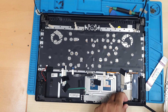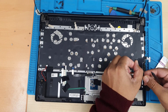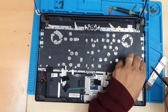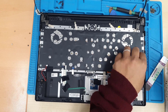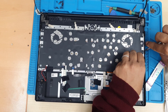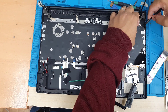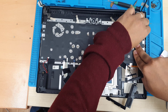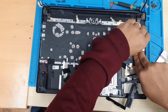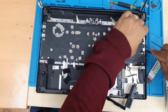This is the most difficult part. After removing the speaker and M.2 caddy, we have to peel this film off gently. Make sure you don't put too much force, otherwise you're going to rip it. We need this film protector because if the motherboard gets contact with this metal, it could be completely damaged. But we have to peel it off — we don't have any choice.